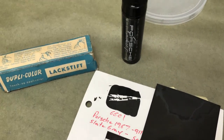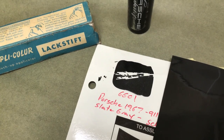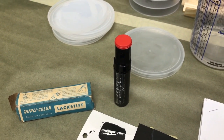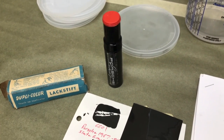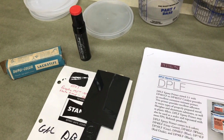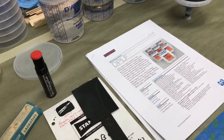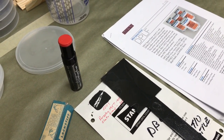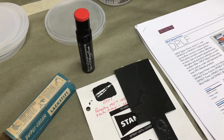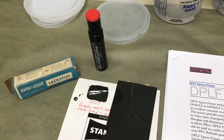On this color match, I was able to do a little color swatch on a sample card for the paint shop. What they did then is they took this color and did what's called a spray-out — they spray from the original paint because it's still liquid. But the problem with the older color, especially if it's lacquer, is it doesn't quite cross over to urethane base coat/clear coat like you think it would, so they have to do some tweaking. Even in the 21st century, trying to match these old car colors is not quite as computer-simplistic as you'd think. Some of them they just don't have the data. Depending on brand to brand, their pigments and base colors are going to change and not necessarily be interchangeable in their formulas. The best way to get there is if you've got some original paint on your car somewhere that you can take to them so they can match it up.